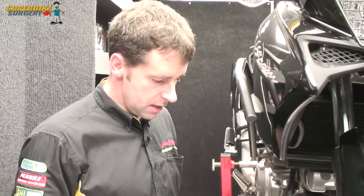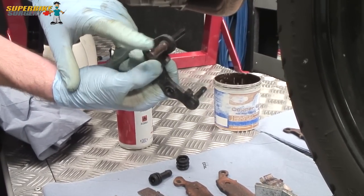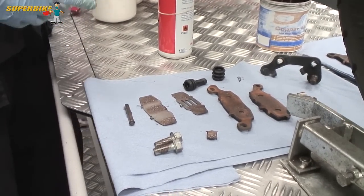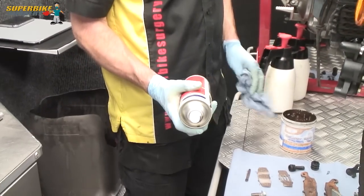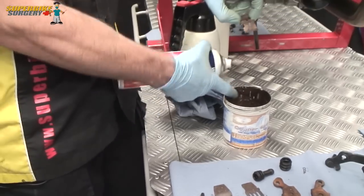The callipers are all washed down, cleaned and covered in silicone spray. I've got all the components washed, dried, laid out and covered in copper grease - backs of the pads, the calliper carrier where the pads slide, the bolts that hold the calliper on, and the pad retaining pin all have copper grease on. I use both copper grease in a normal tub and aerosol copper grease. The aerosol is great for little components like the anti-squeal shim - you can just lay it out on the bench and dust it on both sides rather than trying to scoop some on your finger.